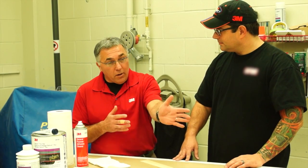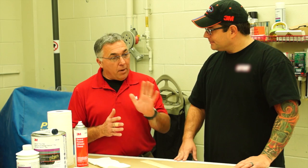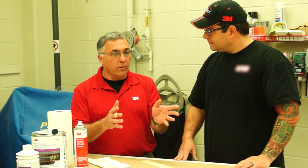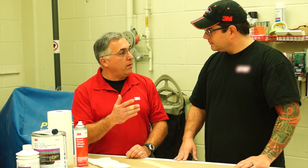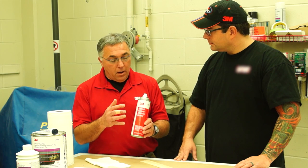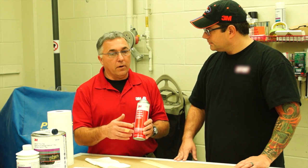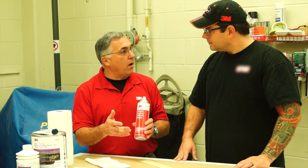After you ate some pizza for lunch and you ran your hand over that sheet metal panel, probably not the best residue to make body filler adhere to. It is really common for a body man to run his hand across the sheet metal — nothing wrong with that because he wants to make sure the panel is straight and prepared the way he wants it. It's just that the last thing you want is to not clean the surface with some sort of a good final clean, a VOC-compliant surface cleaner that's available in your area.